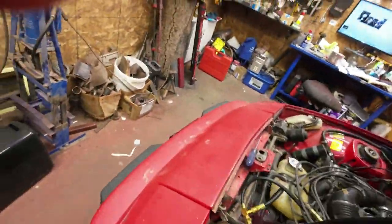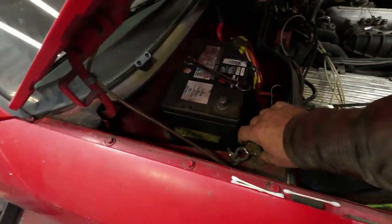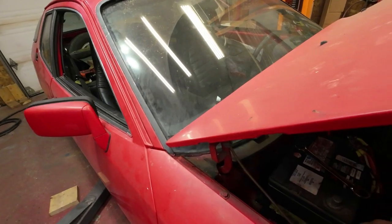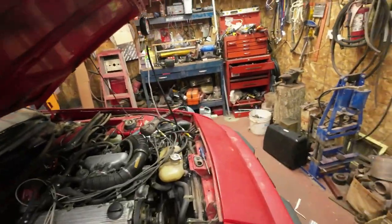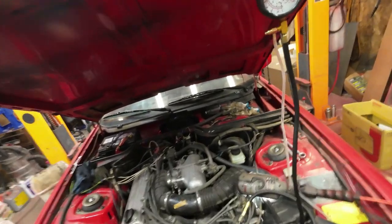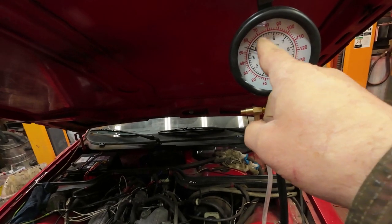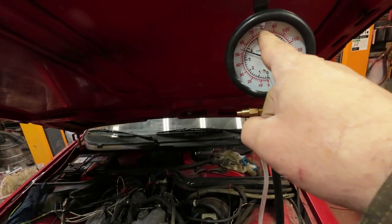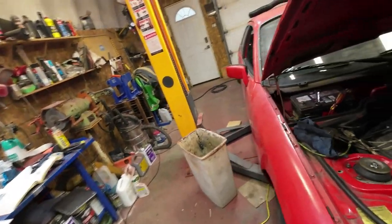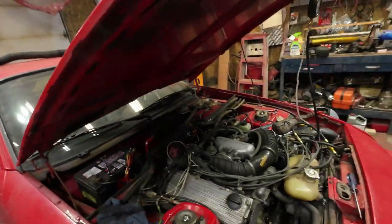So the next thing to happen is over here, we hope that's right. Anyhow, when I hook this on, I should hear the fuel pump go. Yeah, so the fuel pump's running. Okay, then with the fuel pump running, it should be between 4.5 and 5.5 in around there. That should be cold. That should be the system pressure.